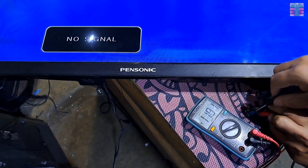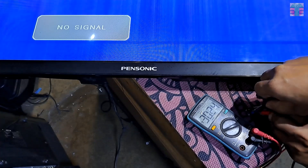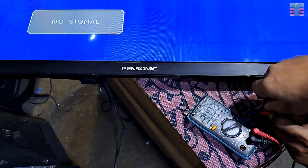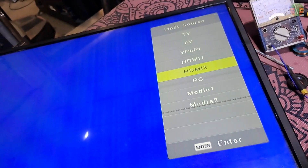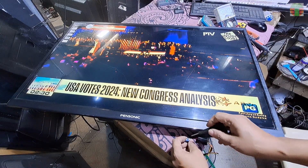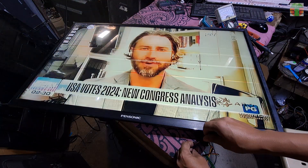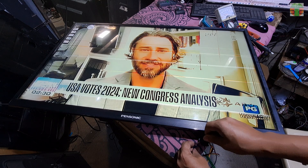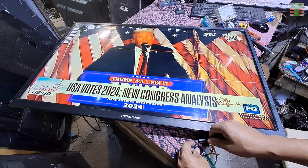Let's try to adjust the DC-to-DC voltage. At 22 volts, the image looks better. Let's feed a signal and adjust the voltage. The panel does not look good. This is a no-gate-on-glass panel — there is probably a chip-on-flex at the side of it, and it may be defective, resulting in the poor image and the horizontal lines on the screen.